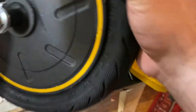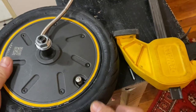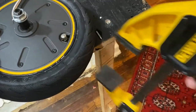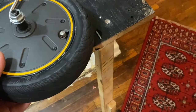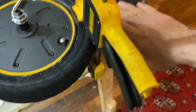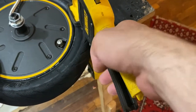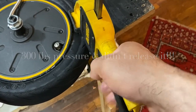Now, once we do this one side, the second side is the one that is difficult to get out. The best way to do it is to put it on a flat surface like this, hold it from one end, then put the clamps on the other side just holding that — so the ring is actually sitting in the wood. The ring is this part of the metal sitting over here. Then you grab your clamps, grabbing the surface where you're actually holding it, and hold it from the other side. Then just press, pressing it, trying to move it from the other side where it is holding.